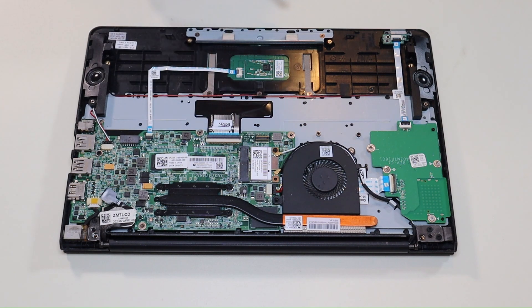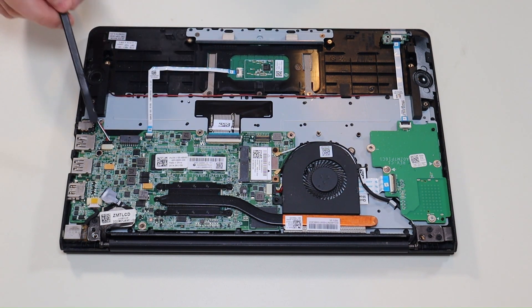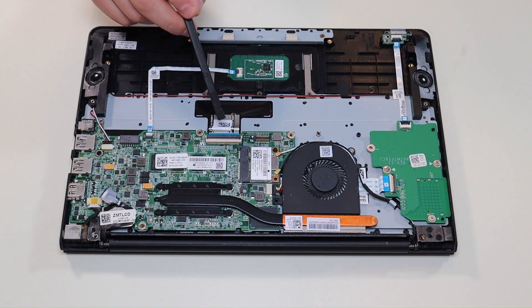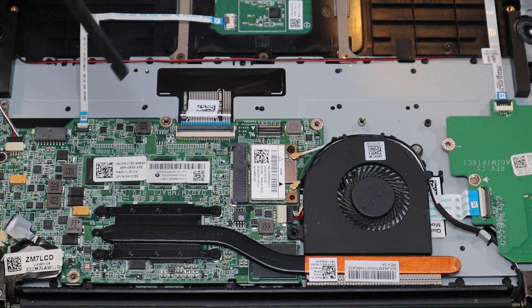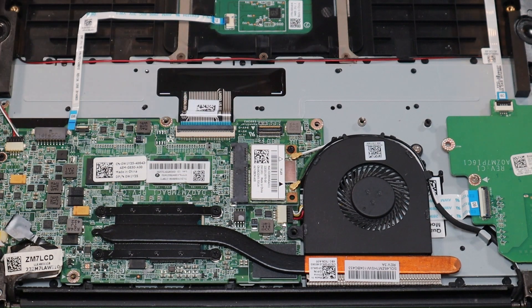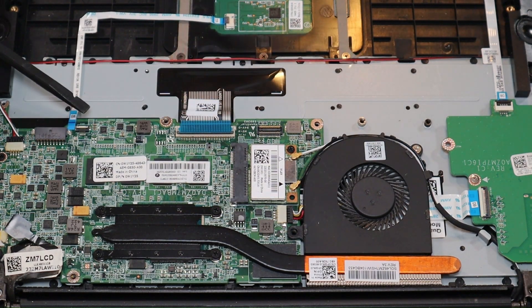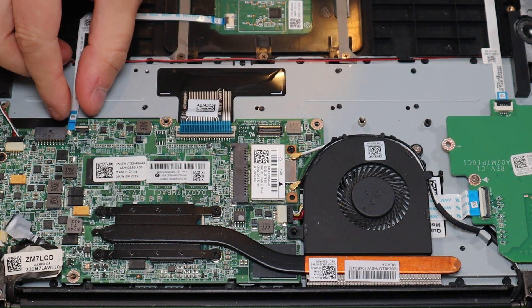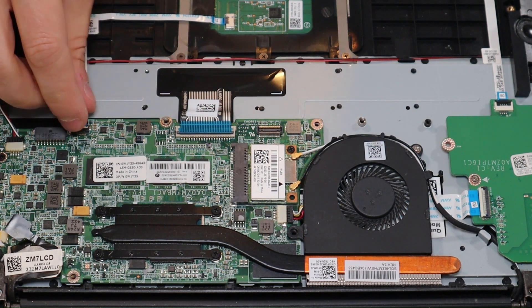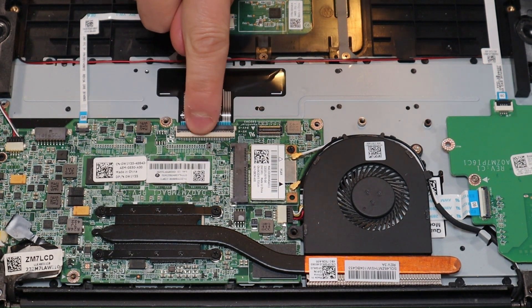To get your motherboard up, you would of course have to unplug everything it's attached to: remove the fan, the Wi-Fi card, unplug the keyboard ribbon cable, the touchpad ribbon cable, and your speakers. Keep in mind these ribbon cable connectors are very fragile. The way they work: you have a black clip here and a white clip there, and you take a small flat plastic pry tool, slide it under that clip very carefully, and pop it up — then the ribbon cable can come out. I say they're fragile because if you break those clips, you won't be able to secure the ribbon cables in place very well, which may make your computer useless. So be very careful. Once the cable is flush and straight, gently put the clip back down to secure it — same thing with the other ribbon cable.